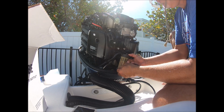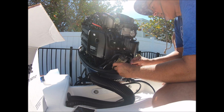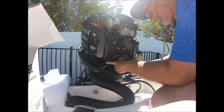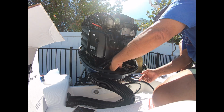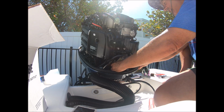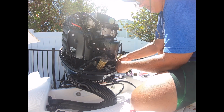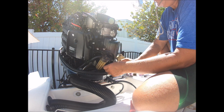Now with this loose, you don't have to jack your wire around. You can just run it under these wires and under that bracket. Which it's much easier with it off. And it slides over to here where you can reconnect it. And you can do this all with your fingers without twisting the wire. There's the bracket. Hopefully you can see that. Or the connector. There's the push tab to disconnect, reconnect it, tuck it back down there.